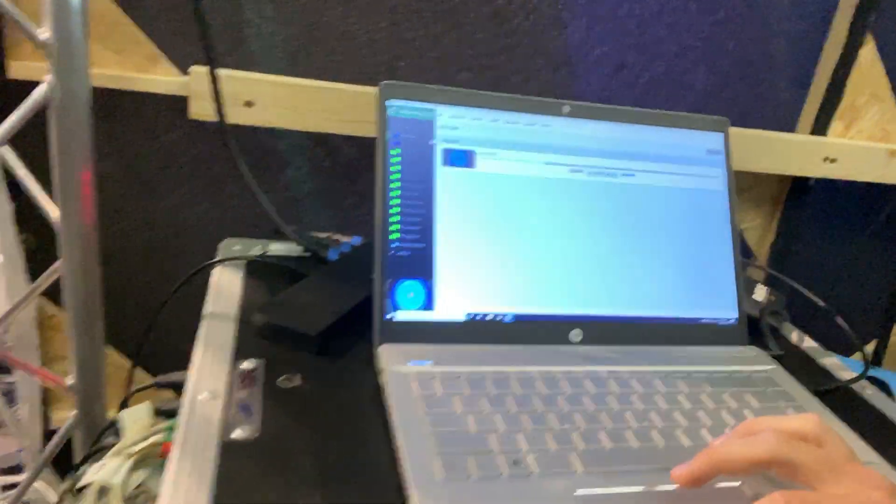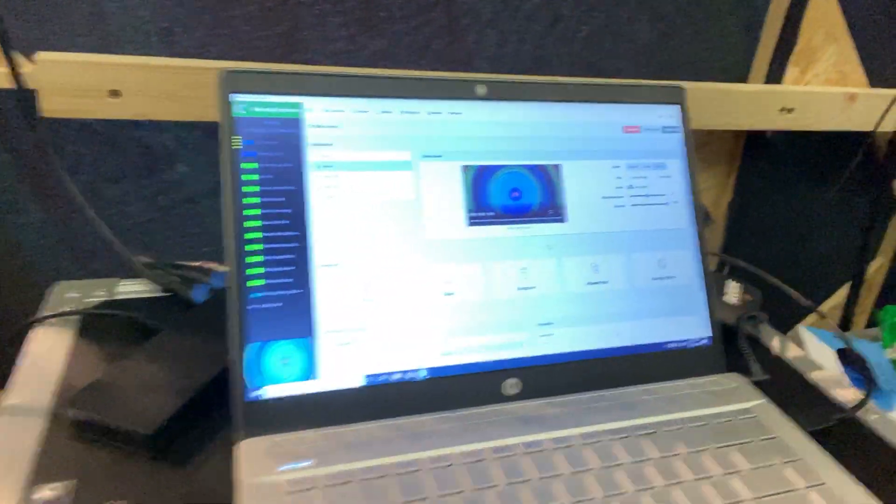The laptop is the normal kind of just HDMI input to go in there. The projectors are set up at 16:10 to fill the screen, so if you run an image in 16:9 you're going to have it letterboxed and miss the top and bottom of the actual backdrop. The easy way to resolve that is in Worship Extreme - when you edit the queue there is a little stretch option, so if you tell it to stretch it will automatically stretch it out. Obviously if you make the content in 16:10, that won't be an issue anyway.